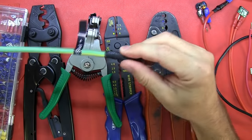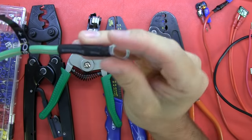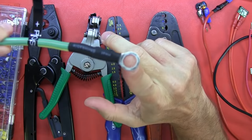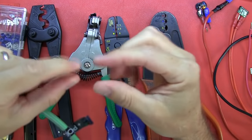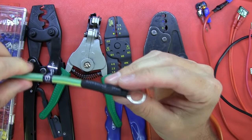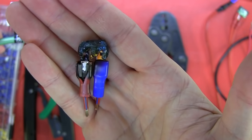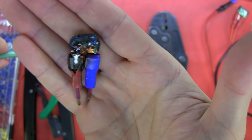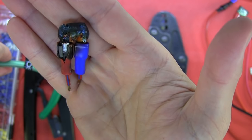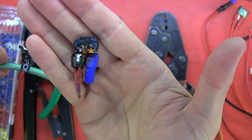Invariably if you're working with either electrical or electronics, there comes a time when it's really handy to have a crimp-on connector to fulfill a certain function. You may want to have a wire that can go onto a battery terminal. You may want to join two wires with either spade connectors onto batteries. So there are loads of uses, but if it's done incorrectly, things can go very wrong quickly — as with this homemade fuse holder used in a solar panel monitoring system — and this could result in a fire.